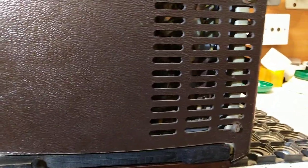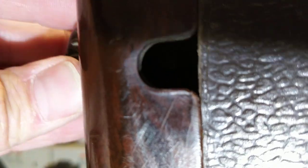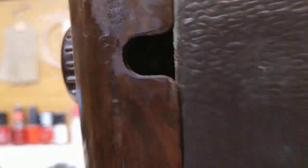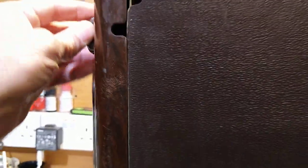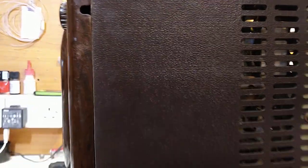Make this loose — we've done the bottom one like so — pull that back very slightly, and you can then see you've got access holes in here and down here. It's really hard, if not impossible, to see where the actual screw heads are. Get a light in there and you'll be able to see it. You're sometimes better off getting a little torch in there. I've done a few of these now so I know where the securing bolts for the knobs are. Have a look and you can take those off before we go any further.